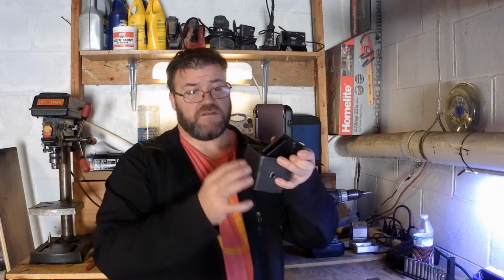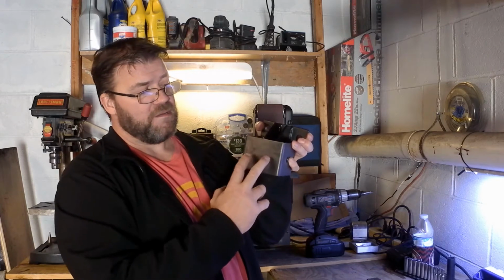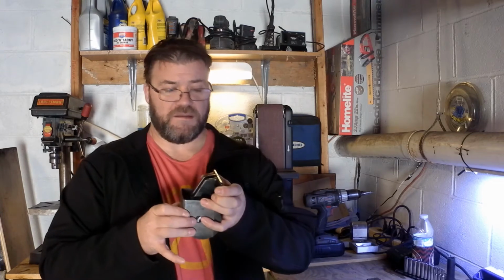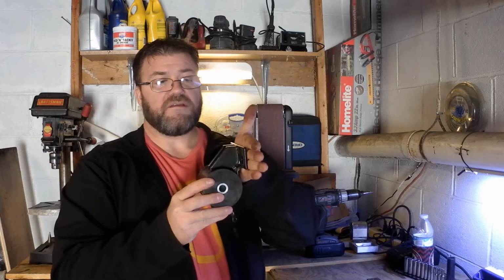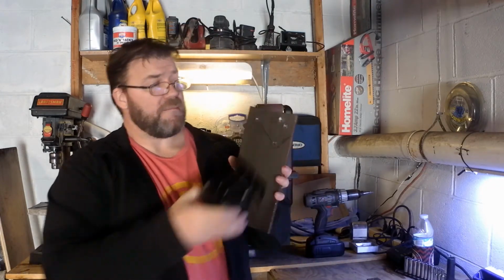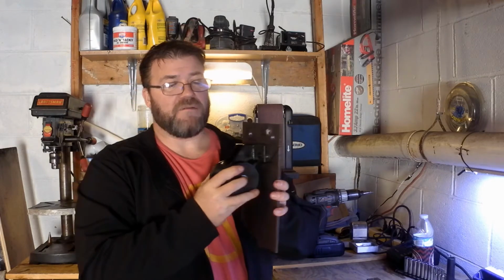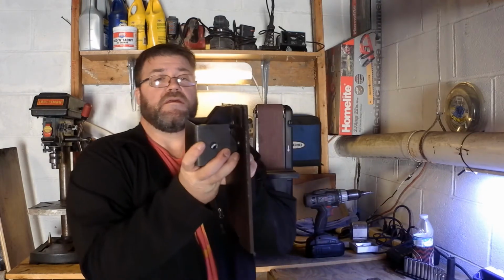Now the adjustability, what I may do is slot here side to side. That way I can kick the engine forward and back a little bit. But also I might open these holes up a little bit, and that'll give me some adjustment up and down. I'm not quite sure. Those are pretty damn big bolt holes, and these are not. So that might give me a little bit of movement, but not a lot. I'm more concerned about front to back, to be honest with you. So this is going to go here. This plate will go here, and that's basically our setup.